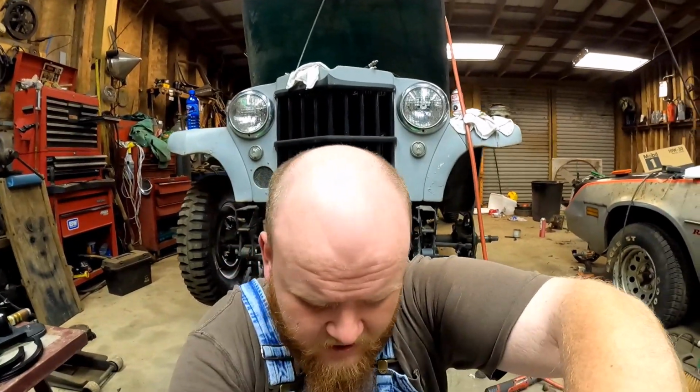I actually had some brake parts because of the subscriber I mentioned in a previous video, the last video I filmed. He sent some brake shoes and some other stuff, so we actually already had that. So that saved me some money and some time, so we didn't have to order that. So it'll have new brake shoes, all four corners. It'll have new brake lines. It'll have a new master cylinder, new hard brake lines, new rubber lines.